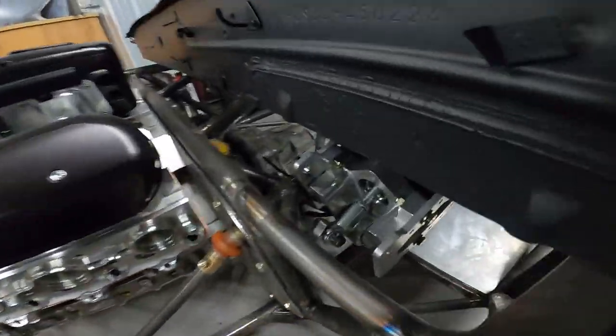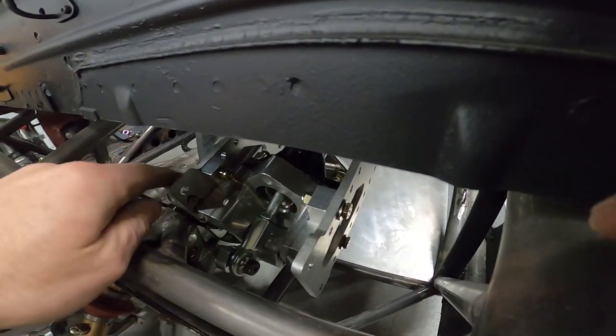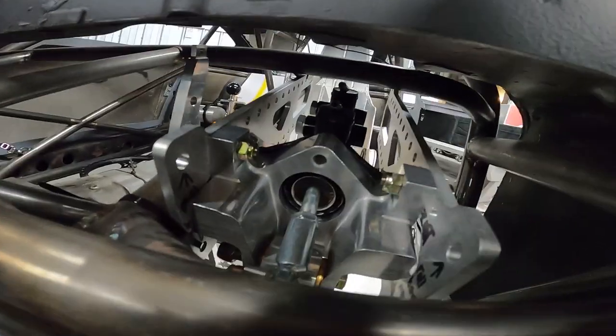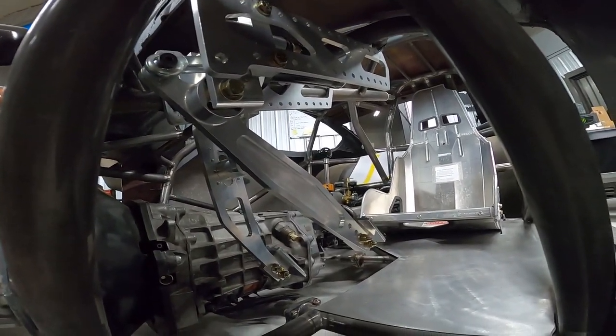Let me show you from the front side so you can see how it hooks up. I had to offset the bracket a bit because of the way the gussets are up there, but I can get something right here to support on this bar — weld a tab or something — and then get a couple of tube clamp-style supports up front. I think we'll have ourselves a pedal assembly. Not nearly as hard to work out as I thought it would be. I've sent all the info over to Ryan and we're going to go back and forth on the best option. I just got excited when I put it in the car, so I wanted to show you how it actually sits in there without me holding it. See you next time!